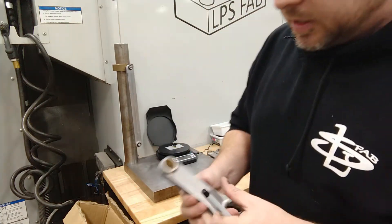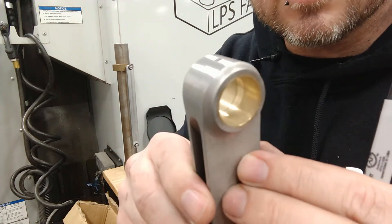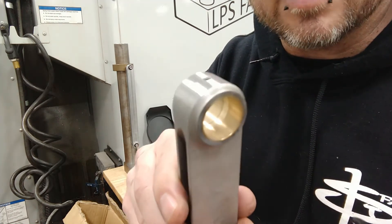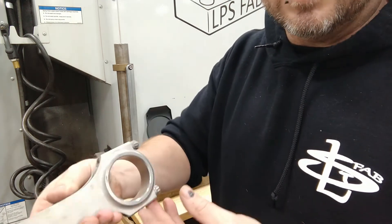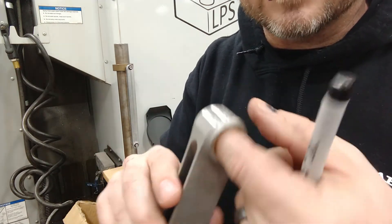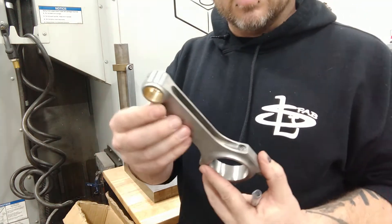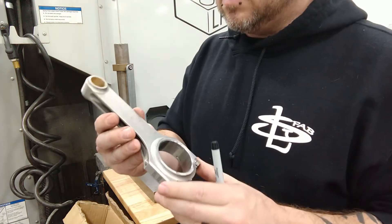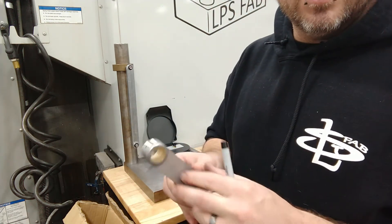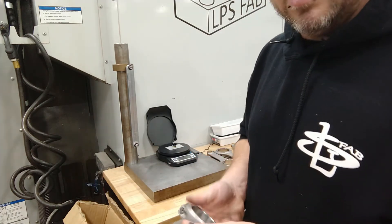One of the things I don't really like about these rods is — you can see it's got a groove machined into the bushing. That's kind of messing with my rod balancer a little bit because it's not a flat surface to sit on. It also takes away some of the surface area that your oil is going to be able to load on your piston pin. I don't really like that about these cheap rods, but they're cheap and the engine's not going to make a ton of power, so I'm going to run them anyway.